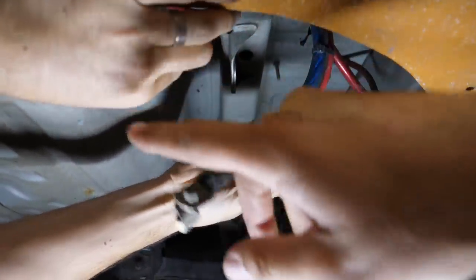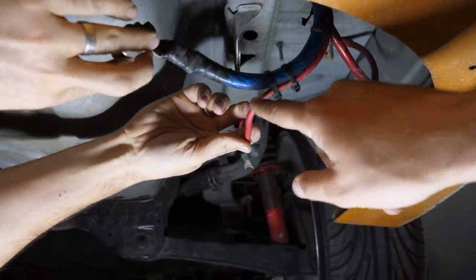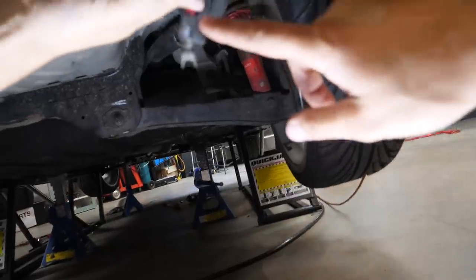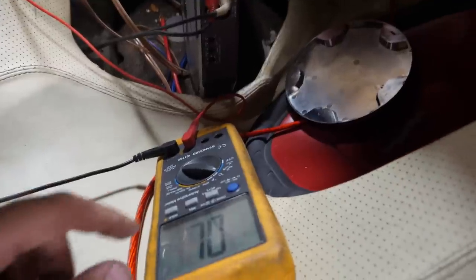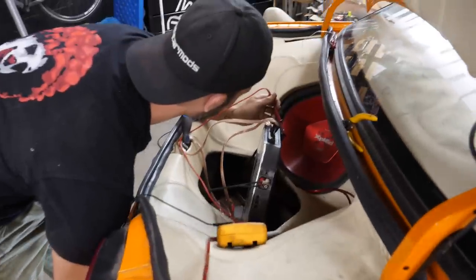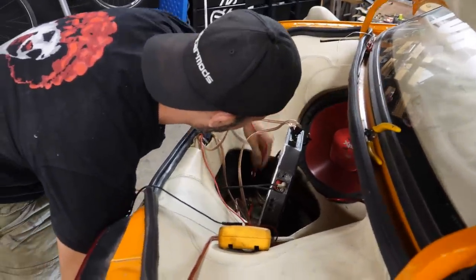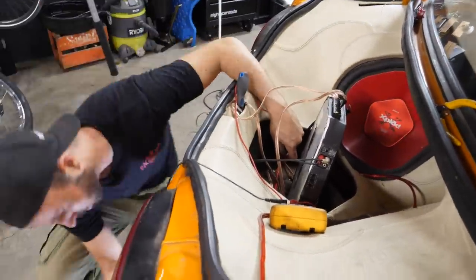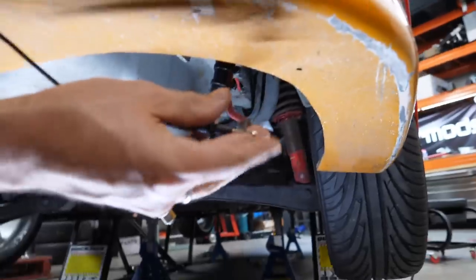So what we can do is grab the multimeter and buzz that one out, and then if we want, we can hook our battery wire up to that, because that's what will run through the car eventually, after we've tested everything. We can buzz this one out here. There you go, so that's ground, as we thought. This one here, that we think's power, is not beeping. I reckon it's going to be that other one that was hanging next to that, which I reckon is going to be this button. Try it, man.